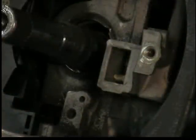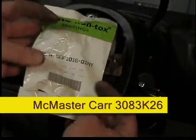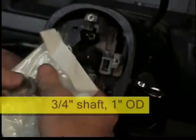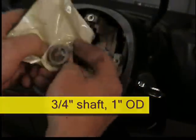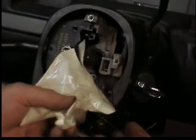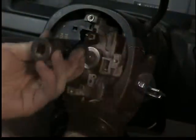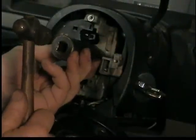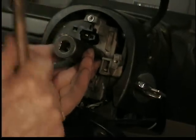All that's left is the outer race and I can't pull that out because the shaft's in the way. So I ordered up this brass bushing from McMaster-Carr. It's a flange bushing so it won't push down in too far. Just going to tap it in with a hammer — that'll take up all that extra room and the steering wheel won't wobble so much.